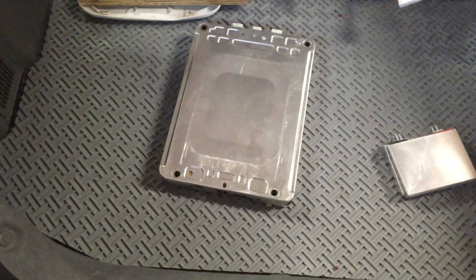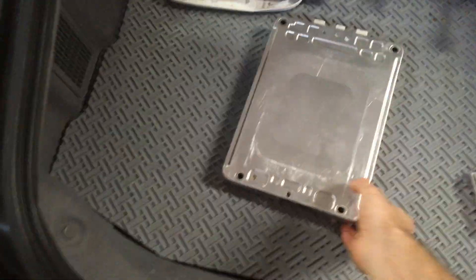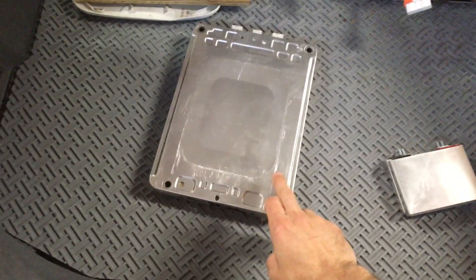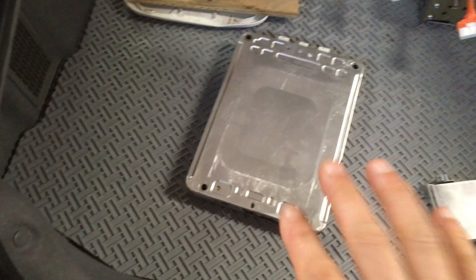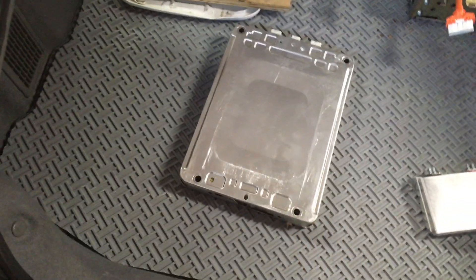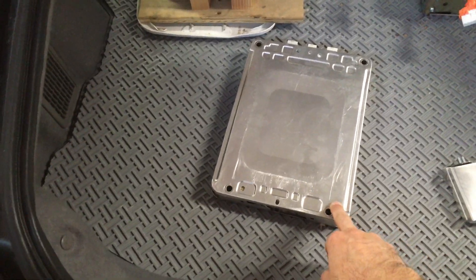Putting 48 Leaf cells in the OEM bay was not possible; 36 was possible but it's pretty heavy. With the 50 amp hours you end up having about 10 kilowatt hours of battery storage, which is a lot. That's great, but it was kind of expensive, and at this point these batteries are getting a little bit old. The new Leaves have better batteries - this is a 2014 Leaf module.